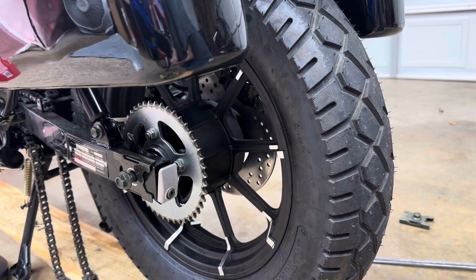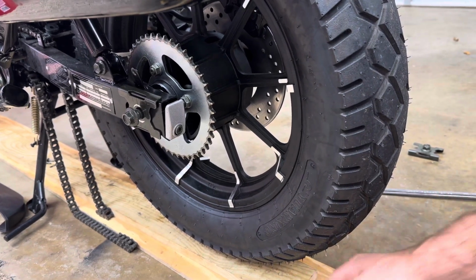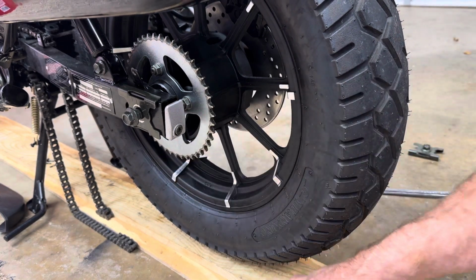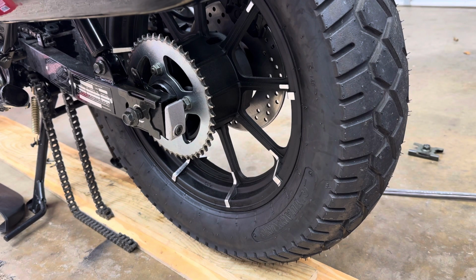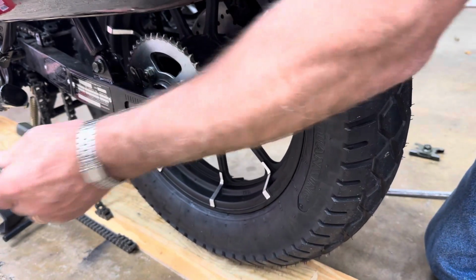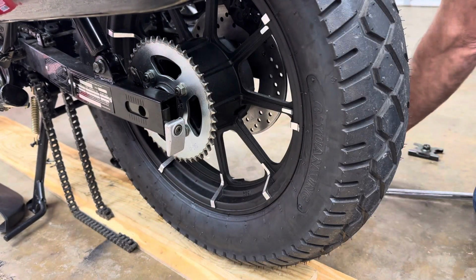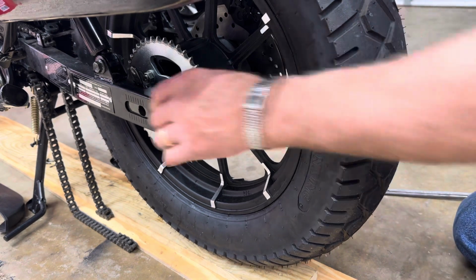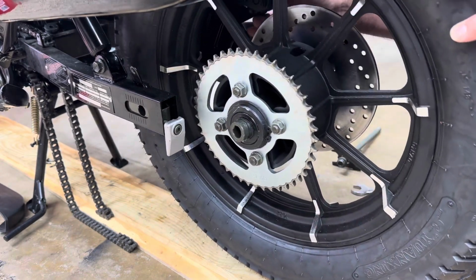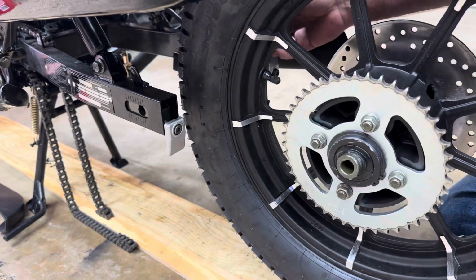And I don't know if you can see it or not. Let me lower it down. I put a couple of boards under here, and it's just enough to where it'll clear. So when I take that bolt out, it'll drop down and hit this and not go down so far. I won't have to fight it so much. All right, now we'll take the bolt, the axle, all the way out, like that. There's the axle, and it's got another plate on this side. And then we'll just work it out. Like that. It makes it easy whenever you got it on the boards, because you could just roll it out of the opening in there.